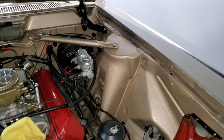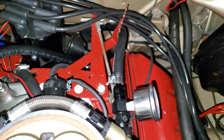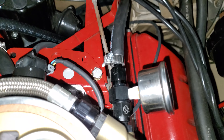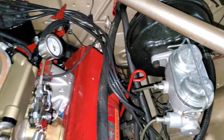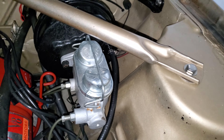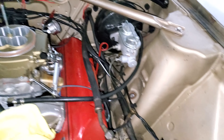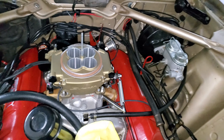One thing I'm going to do today is that fuel line — I just don't like where it's going. We're going to put it down towards the center because over time I'm sure it'll rub on that. We'll fix that, and then this line coming off here is actually for the O2. We're going to put the O2 on the driver's side piece of the exhaust, probably right behind where the manifold collects, or behind where the Y-pipe collects depending on how much length we have in that wire.